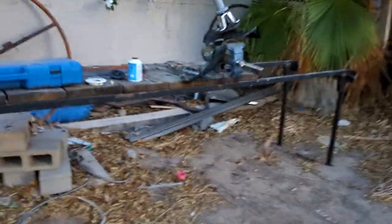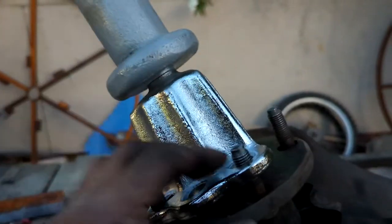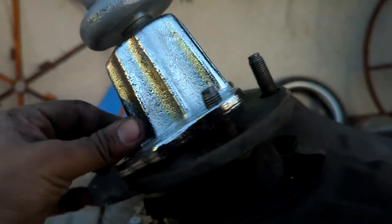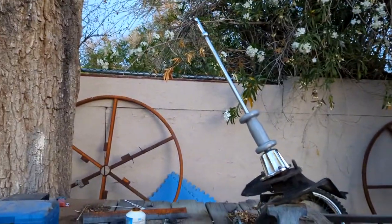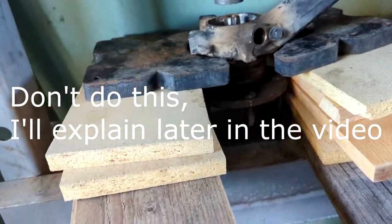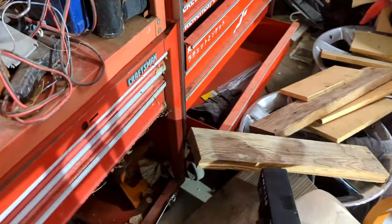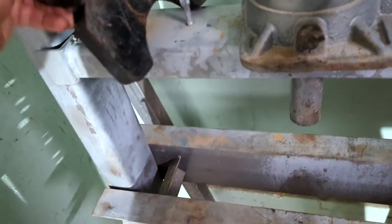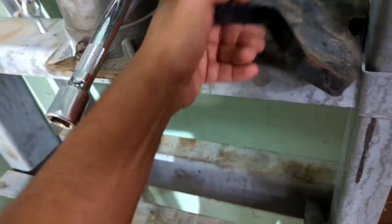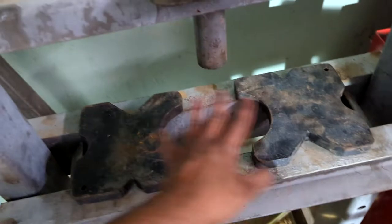So it's 5 a.m. and the sun is coming up. I've got to find three lug nuts that I don't really care about — I have my nice fancy gold ones that I don't want to strip the threads out of, or even the studs. This should be safe. So the end result — this thing is pulled out. What I ended up having to do is I stacked it up on some wood, but these little plates would start to sink in and the whole thing would come off. So what I ended up doing is I put a wrench and a pry bar on both ends side to side to flatten it out. They both got bent, but it worked.